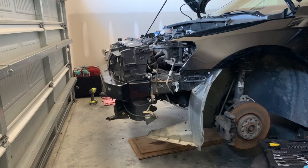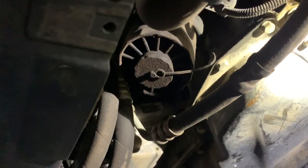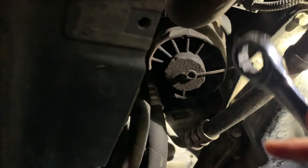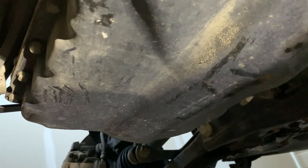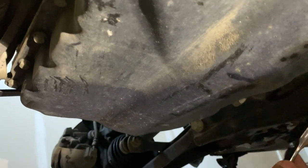I'm about to change the oil and the oil filter on the car. Let's get to it. So we're going to change the oil filter — this is it right here. And then to drain the oil, this is it right here. You could use a 19mm or 3/4 to pull it. So let's go.